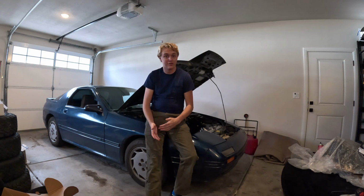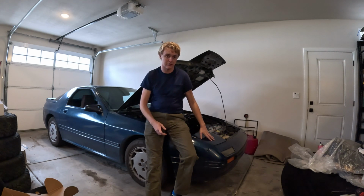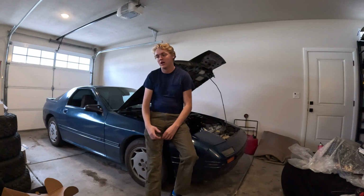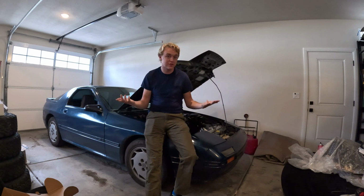The point of this video is, if you have one of these cars, or really a lot of this will apply to any car in general, what you need to do when your car's not running right. Could mean a multitude of things, but when we really break it down, every internal combustion engine, rotary or piston, is gonna need air, fuel, and spark to run right. And to run right, it's gonna need all three in exactly the amounts at exactly the right time. So what I'm gonna do with you is diagnose spark, fuel, and air and find out which one's causing my problem.